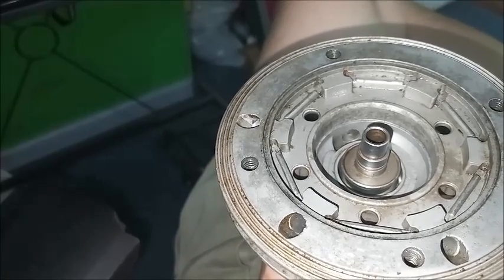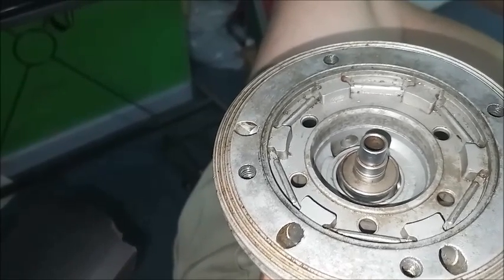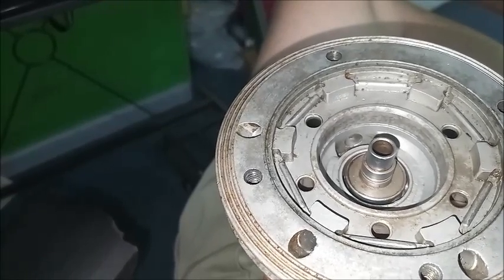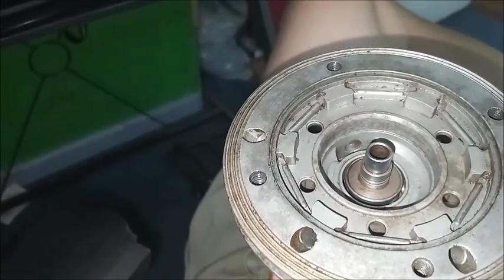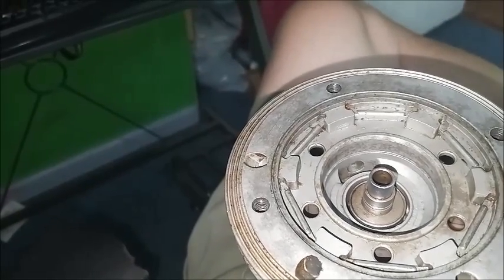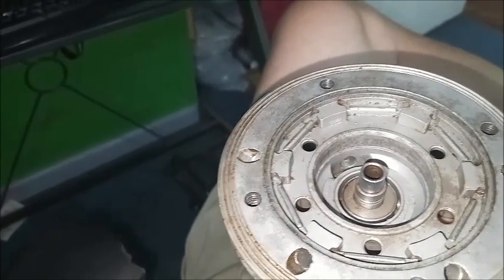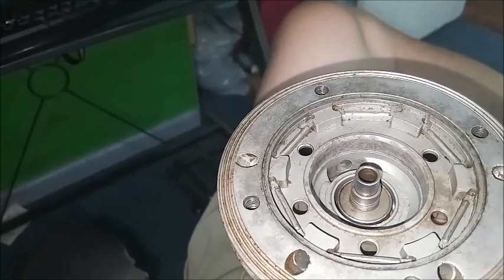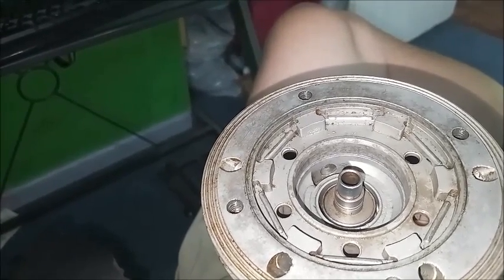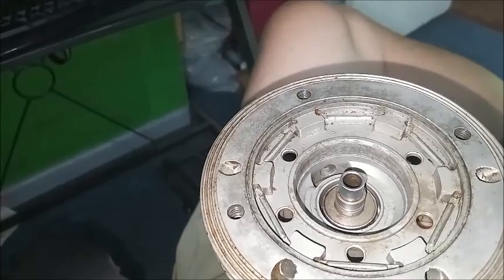And as you stop adding to it, but just hold it, the air valve is pushed back to an even level and both are blocked off. And then when you're releasing, the air valve goes back and air is allowed in. So either vacuum or atmosphere are allowed, but not both, and sometimes neither.